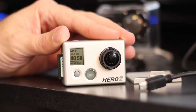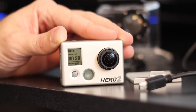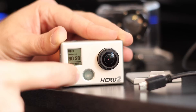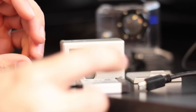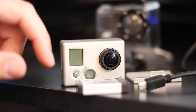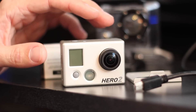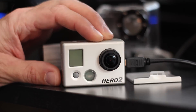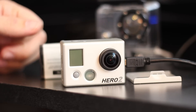This is what you've got to do to get things working again. Unfortunately it does not downgrade you, but it'll at least get you working again on version 222. Let's put the memory card back in — no change on the screen, it still doesn't detect an SD card. We're going to have to do a battery pull. I actually have a little piece of tape on the back of my battery to make it easy to remove. Make sure you have Cineform Studio open, then plug the USB cable into the camera. Notice the rapid but very dim red flashing light on the front LED — that's what we want to see.